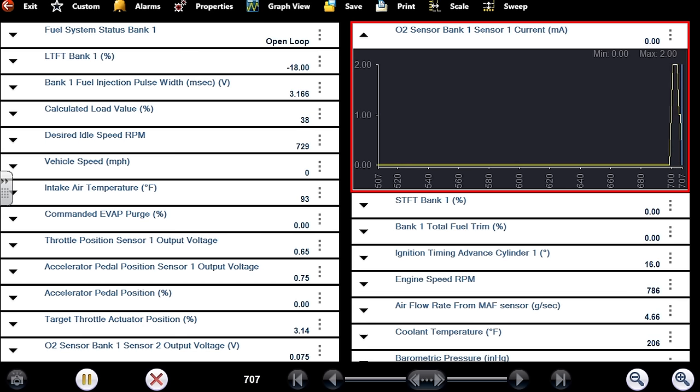There's a stink bug in there. We've had those do stuff before. What if it got sucked in and was diffusing the air? There's a diffuser right there — it would have been getting sucked in. There's no way a stink bug is over-estimating airflow... but the airflow sensor sits right behind that diffuser — the air straightener — and that was behind the air filter. It's a stretch. I like the ten dollar approach — if this doesn't fix it, get us a ten dollar used mass airflow and let's go with that first.